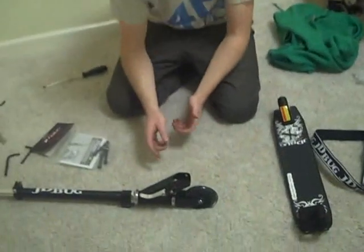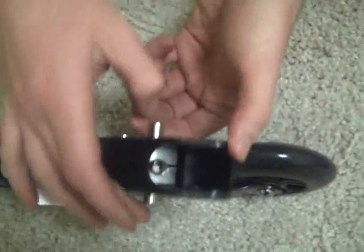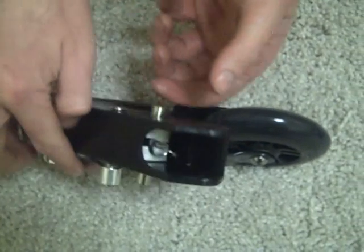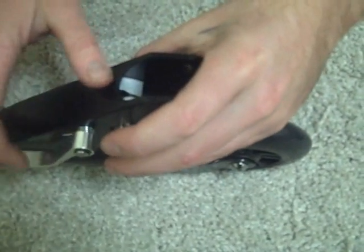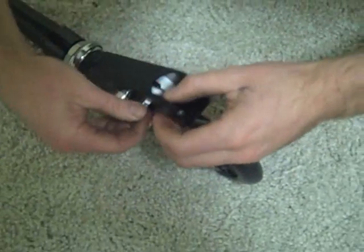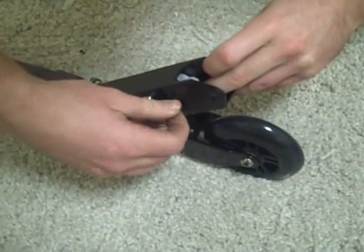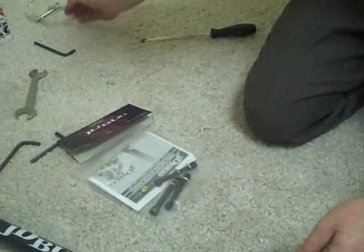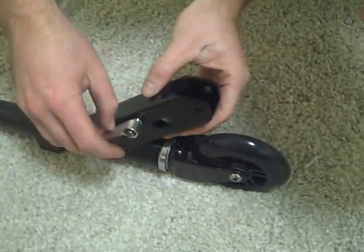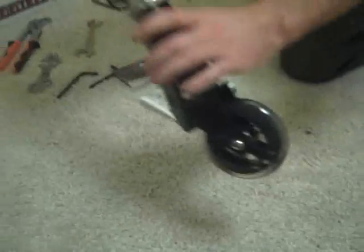Our JD is in two parts. Now what we are going to do is remove all of these bolts and parts of the folding mechanism before we can put the stronger bolts in. Inside there you have got the spring and all the gubbins for making the folding mechanism work and we want to remove all this. So if you push down your handle here, you will see the spring can pop out the bottom and then we want to slide this bolt out the side. Your spring might get in the way like it did on the previous bit — you just have to fiddle about and get it unattached. It should pop out like that. Cast that to one side — watch out, it will be greasy. Then remove your spring so it's not rattling around inside. Spring is out.